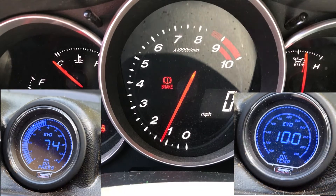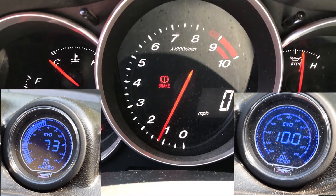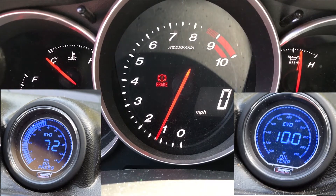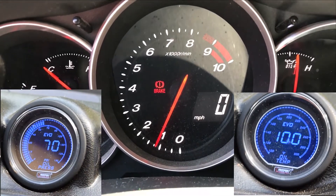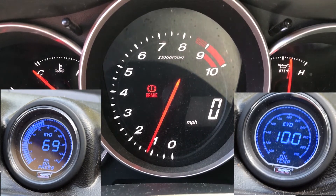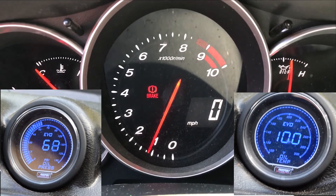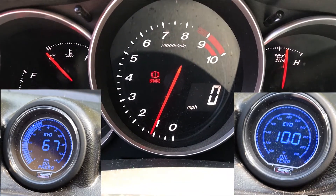That's with 20W50 oil. The idea is that this has an upgraded oil bypass regulator. It sits in the rear iron and it regulates the pressure at which the oil can bypass the filter. This car had the stock bypass oil regulator set at — I think these are set at 80; some FDs are set at like 100 or 120. We never actually tested this one, but it's either 80 or 100 — not that significant. But this one was crushed, which is a really common old school rotary trick.